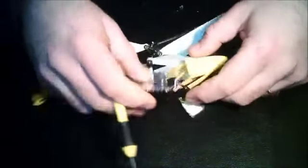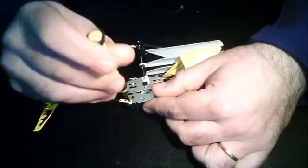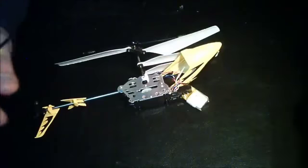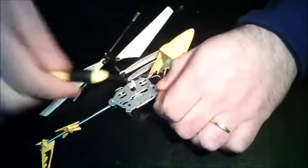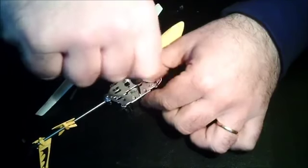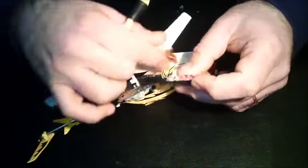So let's go to the other side. Okay, this is the stabilizer rod. Should keep it aside. Now the other one, same process. Just take the other one aside. On this one, you only need to remove the bottom screws over here, and the PCB board should be, there you go, freed. Now it's loose.